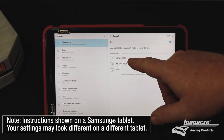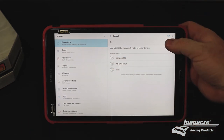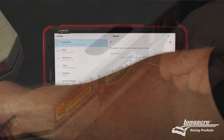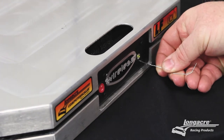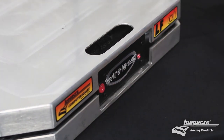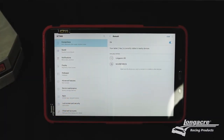You don't want to just touch on that because it won't pair unless you do the sequence. What you want to do is push scan — that starts a timer — then press the reset button on the scale pad, turn the switch on, and wait for the solid red light. Let up, press it again quickly, let go, and then the tablet should chirp to pair.